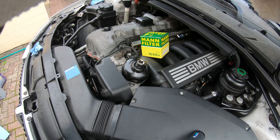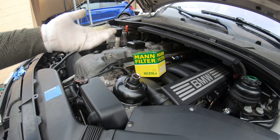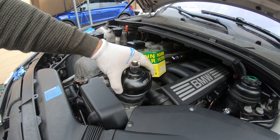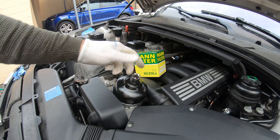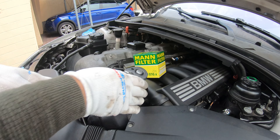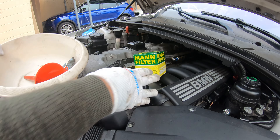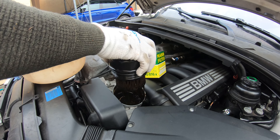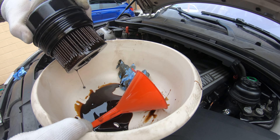Next, we're going to turn our attention to the oil filter. You'll need this little oil filter adapter — I'll put a link in the description below, but just get anything. This is a KS Tools 150.9343. Just go to Amazon. This one has a 3/8 adapter on it; you can get different ones with a socket on top. Just get one that works for you. And again, lefty loosey — just undo this. Don't forget to get another little bin to put the old oil filter in.